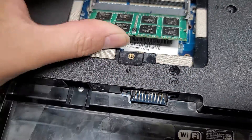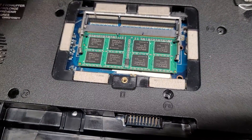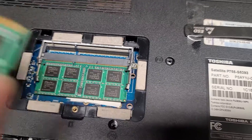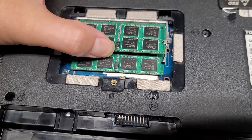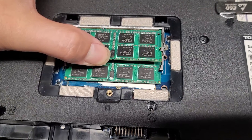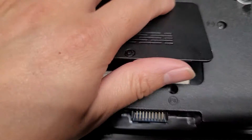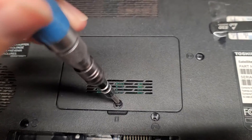Make sure to pop your RAM out and you'll want to match the type of RAM. Usually it'll be labeled saying PC3 or something — DDR3 will probably be something like PC3-12800S. You'll want to match that, and then you can get any size stick of RAM you want. We're going to close that up and put that screw back in.